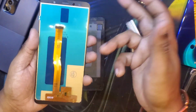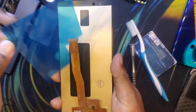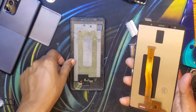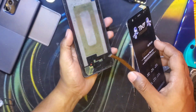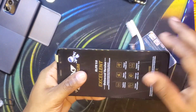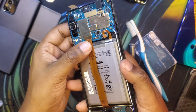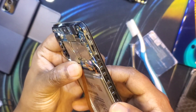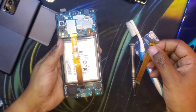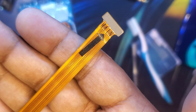You can see the blue protective plastic — we need to peel those off before adhering the display to the device. There is also a front protective plastic; I recommend keeping it on until the end, otherwise glue can seep to the front of the display and cleaning it off is a hassle once it hardens. Before adhering any replacement parts — display, battery, or anything — I always like to test-fit the part first: connect everything up, power it on, and test functionality before actually gluing or screwing it on.